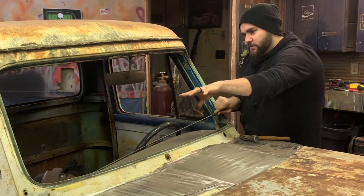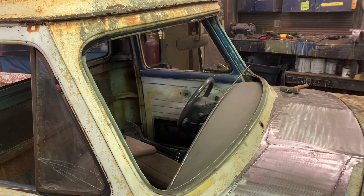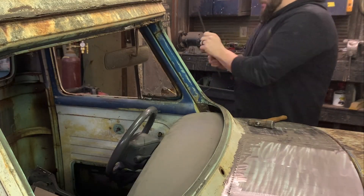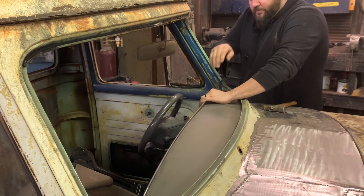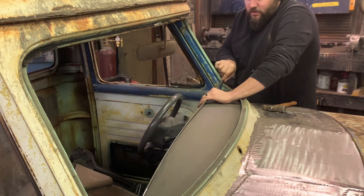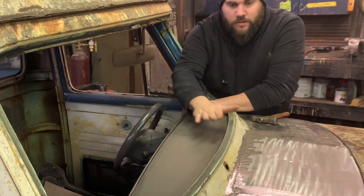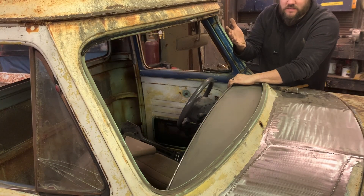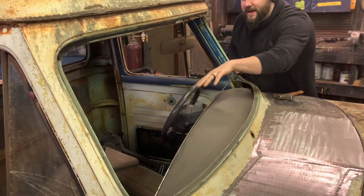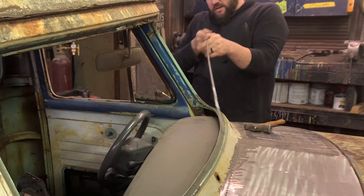The way we're going to do that is I got some quarter inch round bar, and I'm going to trace it across the top of the dash. I already kind of banged it on the ground a couple times so it's got a little bit of a curve to it, but I need to do more than that. I want to have it match as best I can, then I can weld this rod to the cab. I'll probably have to put another rod or two to keep it holding its shape, and then we can just cover this with sheet metal — put a little bit of a curve to it and tie it all in. So the top of this will be sheet metal, basically like the stock one is, but it will also tie in our Lincoln dash to the cab. It'll look a lot better, be a lot stronger — it'll just be better all around. Let's work on trying to make this fit a lot better than it is right now.